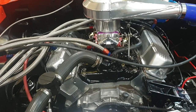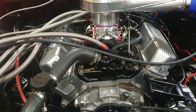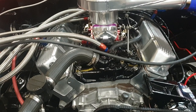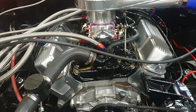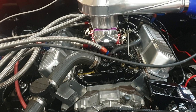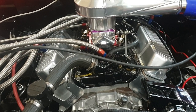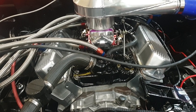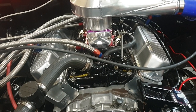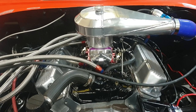I love the old school stuff. I think this little manifold will be an absolute ripper on the 355. They're designed for the 308 cubic inch, but I think on this engine it's just going to be incredible. Apparently they gained 50 horsepower over a performance dual plane manifold. This current one is a single low-rise manifold, but the Peter Michaels one is a high-rise — probably another inch to two inches higher. It's a good old school unit and I've been wanting one for years. She's coming in the mail and I'll do a video on it and look into the history.